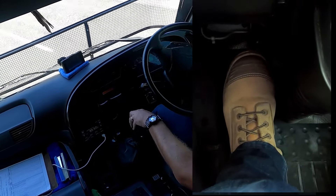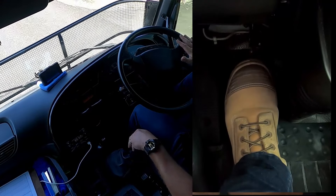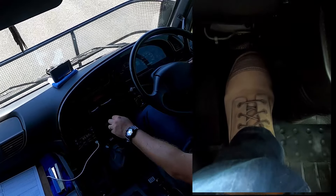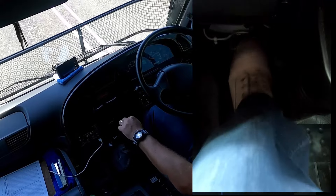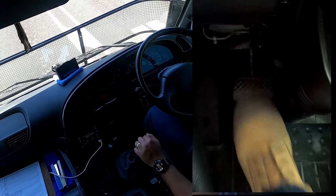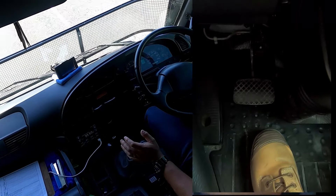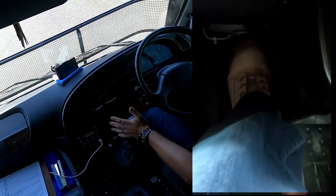And we take off — two half-clutches: clutch to neutral, clutch to gear. We're away now. Select high range box early. Clutch to neutral, clutch to gear. Quite knocky — this is a fairly new gearbox and it's still knocky, so don't be worried about that. They are quite a solid-feeling gearbox. Going through from high-range sixth to high-range seventh — a bit of preloading: clutch to neutral, clutch to gear.